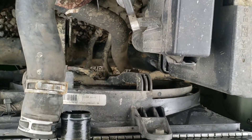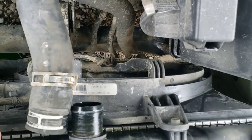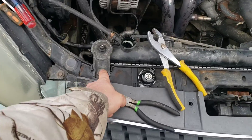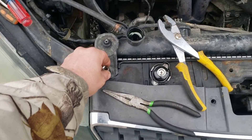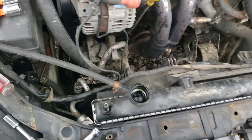Do the same on your bottom one down there. Once the radiator's done draining, you're going to get fluid coming out of that pipe on you. Remove these top two mounting brackets — typically they're a 10 millimeter, which is the case here. So I'm going to work on getting these fans out now.